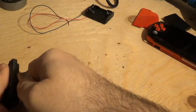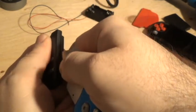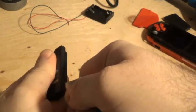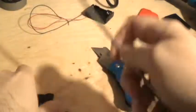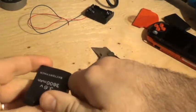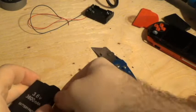I'm going to take a blade and gently do multiple cuts along the seam line that goes all the way around the battery. You don't want to use too much force — you don't want to end up in the hospital. I've already got a little bit of a gap, so I get a screwdriver in and slide it along the side, gently prying to break the seal.